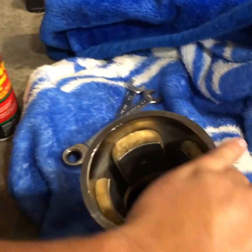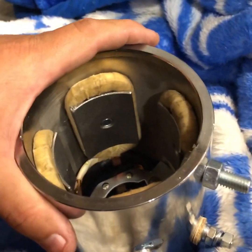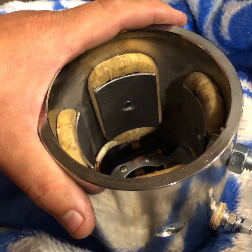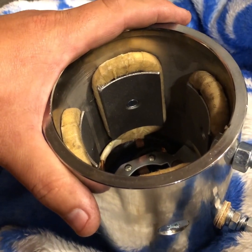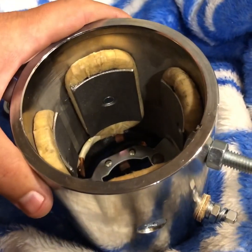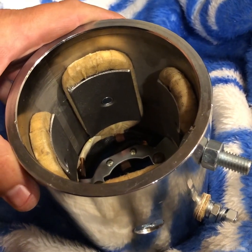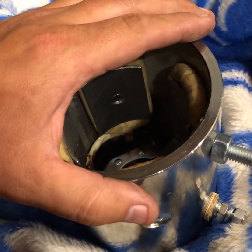The point of all this is to help with grounding — better grounding always means better performance. When you ground the motor, your motor doesn't get as hot, it performs better, it won't burn out as quickly. There are so many benefits to grounding your motor itself. Just relying on the block to ground your motor isn't always a good idea, especially when you start running higher voltage.